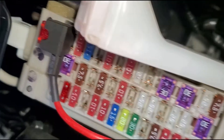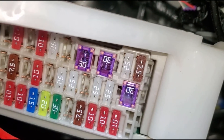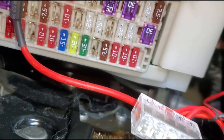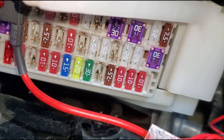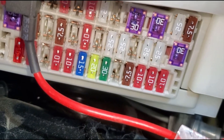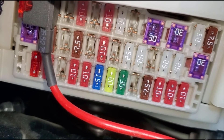It's now in fuse number three, and it covers fuse one, so you can't tap both of them — but that's okay because fuse one is the cigarette lighter and I'm hooking devices up straight to it, so I don't want to put any extra load on that circuit.